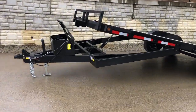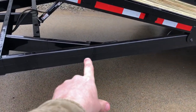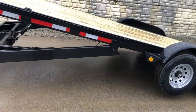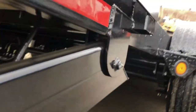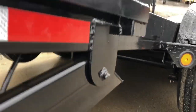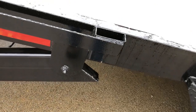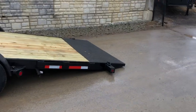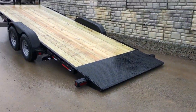What we find impressive on this: normally on most car hauler tilts, your pivot point would be right about mid-deck. This one actually wraps all the way back and tilts farther back. Another thing we like — this has actually got a hinge outside and inside, where a lot of them will just hinge on one side. It's also got a grease zert at your hinge point.